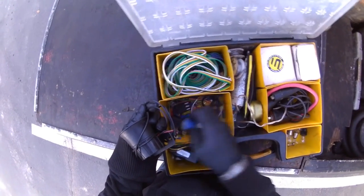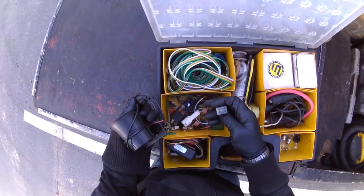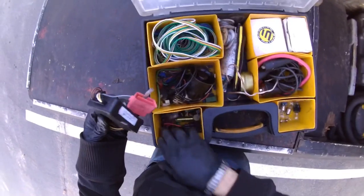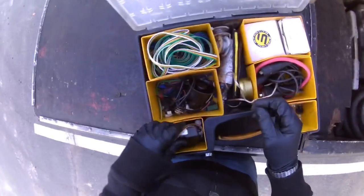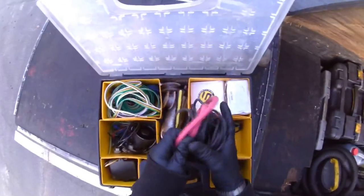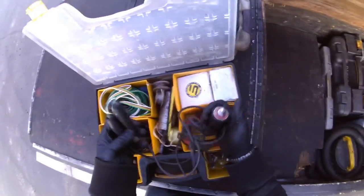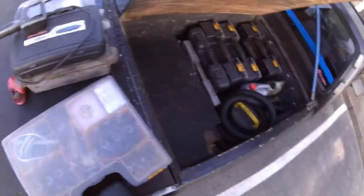Maxi fuses — get some regular fuses, get some micro fuses, and get some maxi fuses. The main fuse on the alternator — some 20s, some 120s. Doesn't take up a whole lot of room. Batteries everywhere, but that's for my equipment. Random hardware: side post connectors and things like that. One good thing to have, which I actually haven't used yet, is a remote starter wire. This allows you to operate the starter, turn over the motor so that you can set the timing, or for diagnosing. It's a high amperage button. Don't use it that often, but again, it'll be that one time.